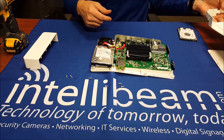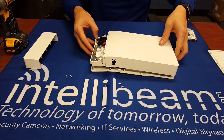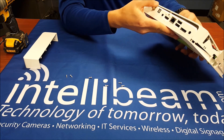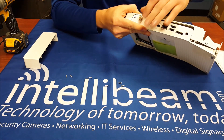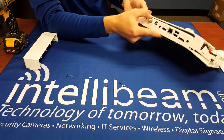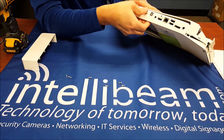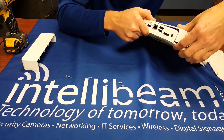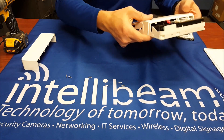Now just repeat in reverse order what you just did and put the case on. You can stop watching there if you like, otherwise here's a tip: this back is almost impossible to line up. The best way, before you put it back on, is to start over where the remote finder is and get that to be flush, otherwise you'll be here forever trying to line up that connector. Once it clips in like that, you can put the remaining clips back on — otherwise things won't line up correctly.